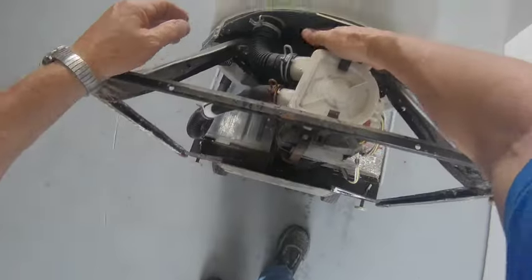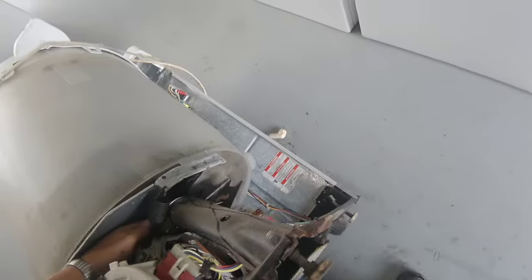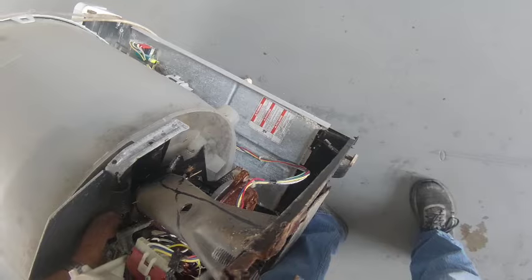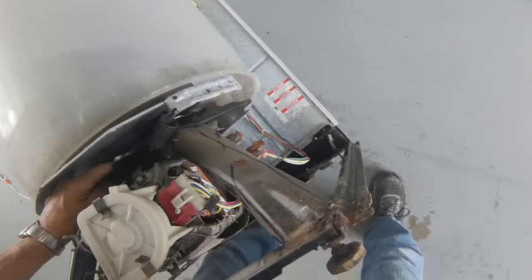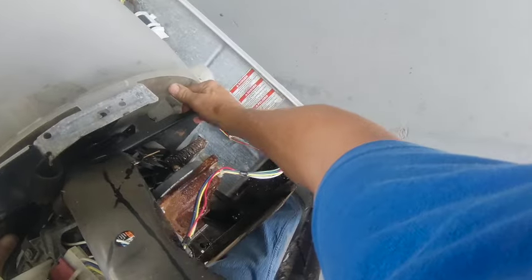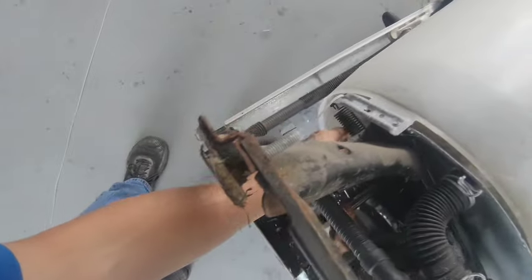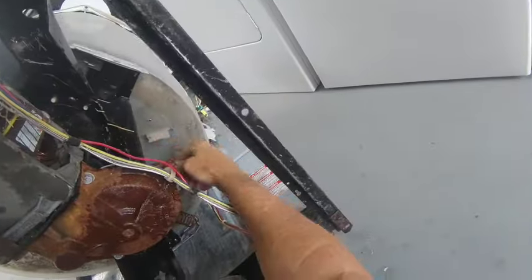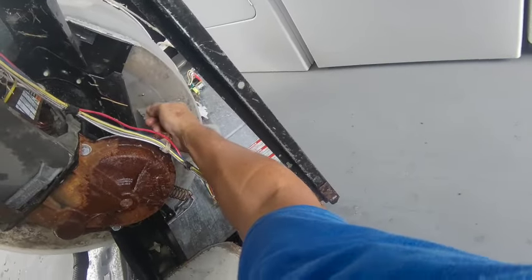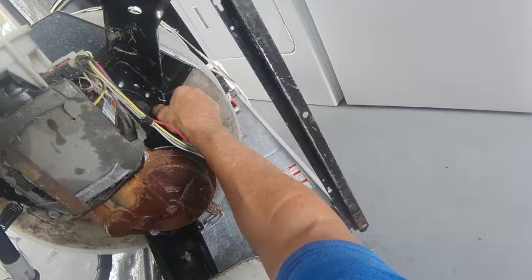So you see this plate right here? This is a triangular plate. And it's not riding on here right. In place. So what has to happen is this plate has to be between these fins. These fins are here to keep it there. And what has happened is this crack. We need to drill a stop hole there. We need to do this.